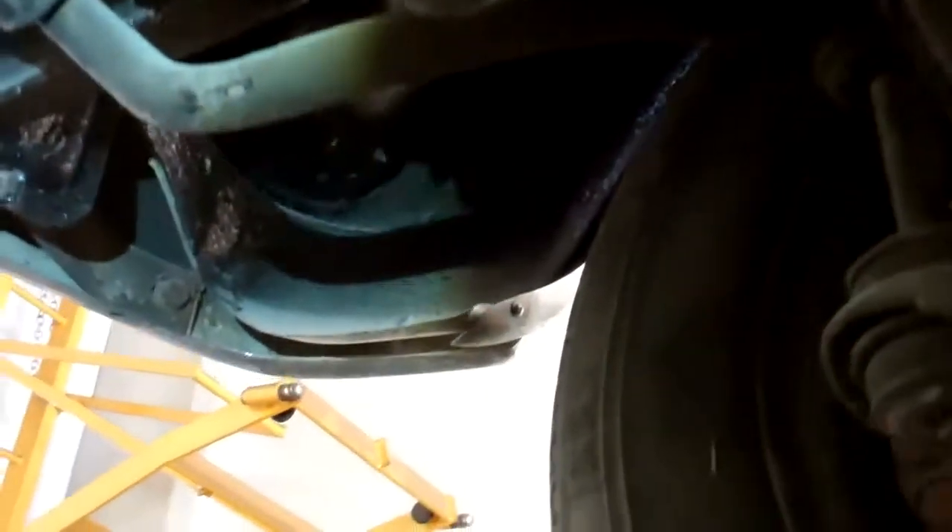The other thing is that the motor mounts are really low. This motor mount looks like it's high, but I would recommend that we think about changing the motor mounts since they're starting to get low. Eventually you'll feel a vibration through the car, and when the motor mounts collapse completely, the fan will start hitting the radiator shroud and it'll start rattling as a result.